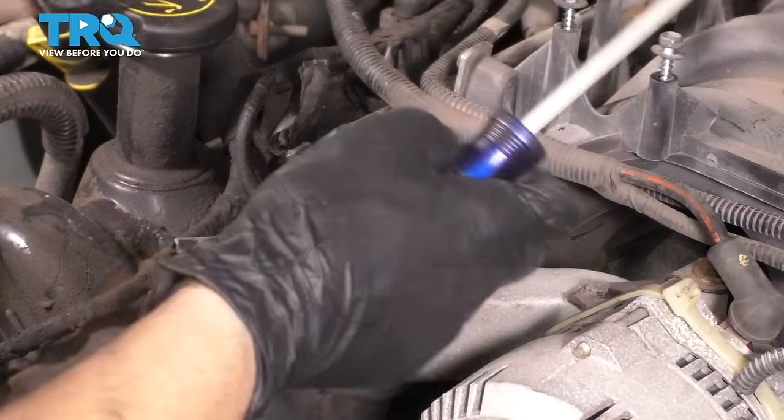So let's put this on. Obviously, I have to start with the driver's side head because this one sits further in, and then on top of that goes the passenger side. So let's start here. I'm gonna put on the guides. I cleaned up all my hardware. On the driver's side chain, you have two different bolts for this lower guide. The long one goes into this hole that doesn't have the flat ear coming out like this one. This one takes the smaller bolt, and that is because this longer one here actually goes through your oil pump and then bolts on. So it goes down just like this.